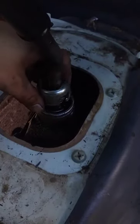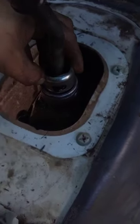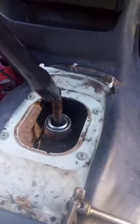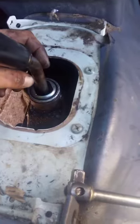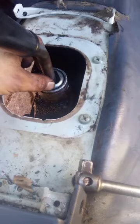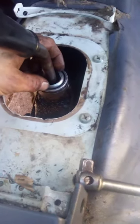Back in here now. You have to sort of push it down and turn it so it locks into place — that way the gear stick won't lift up anymore. The little locking clips were snapped off and it couldn't lock into place. I've put the gear stick in there, flush right in the center, pushed it down as far as it will go, then pushed the locking nut down over that. Now I just need to push it down a little bit more and turn it so it locks into place.